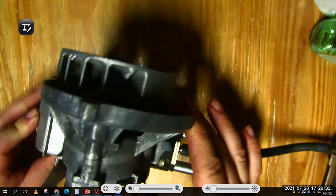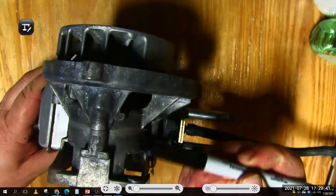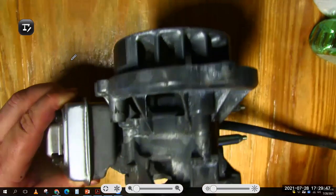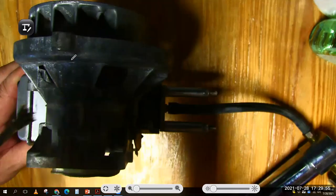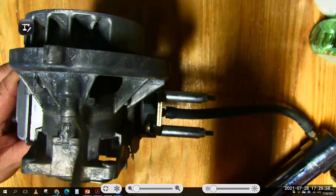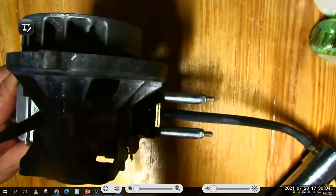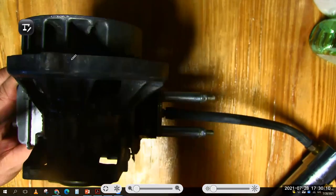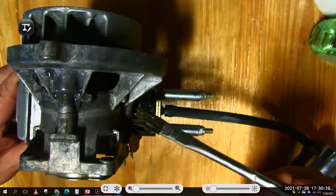And I also want to point out that a 2-cycle engine has 2 case halves here. One there, one there. They're bolted together. There's some type of RTV silicone sealer between the case halves typically. And what we're going to do is take some soapy water. To make sure I didn't make a huge mess on my desktop here, I took some soapy water solution. I'm putting it on a brush and putting it on my engine. But the other thing you could do is just hose the thing down. So you can see if I brush this, it does make some soap suds there.